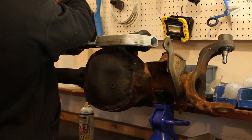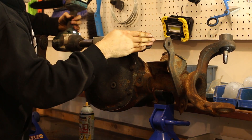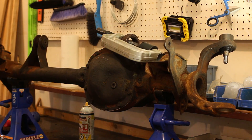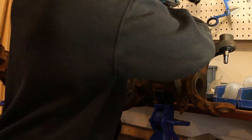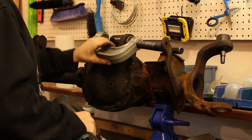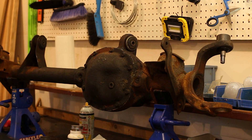Now is also the perfect time to replace the upper control arm bushings. Way back when I did my front suspension, you may remember I haven't done this since I ran out of time. Worn-out upper control arm bushings are what cause death wobble on the Dana 30. Luckily I never got to that point, but still, it's a good time to fit new ones.